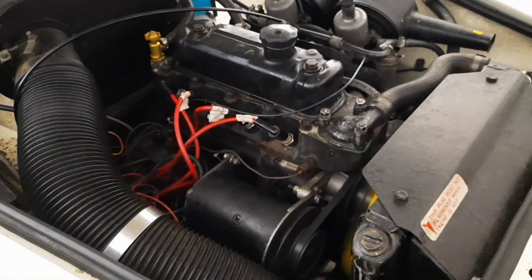You need to get the engine hot before you set the timing. Dave went under the car with a timing gun while the engine was turning over and pointed it at those teeth where the timing mark turns. It reads how the engine is spinning, and then we can adjust by turning the distributor left or right to advance or retard — to speed up or slow down the engine — to give us the smoothest idle and the easiest startup possible.